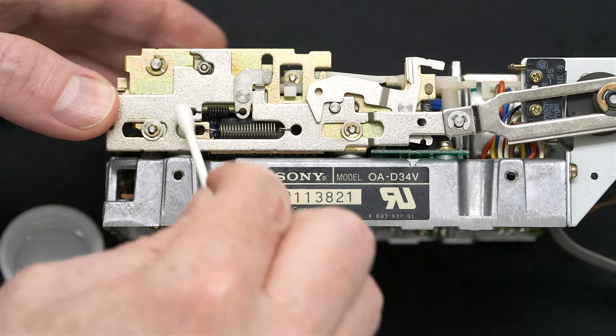And you can sort of hear the buttons being pushed. And just to let you know, directly below the Apple logo, we have the screen brightness rotary dial. So if your screen is dark and you're worried, it could be turned all the way down. By the way, it says that the 4 means here 1984 was the year of manufacture. The 6 means the sixth week. So even though the floppy drive was manufactured in January of that same year, this was made a few weeks later. But of course, you saw the power supply was upgraded in this, but the floppy drive is clearly the oldest component of anything that's marked in this computer.